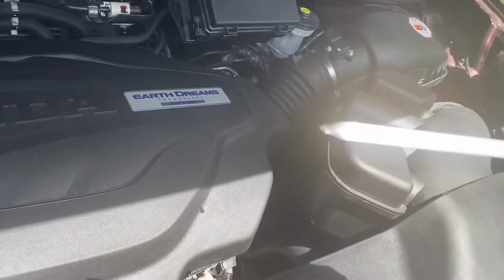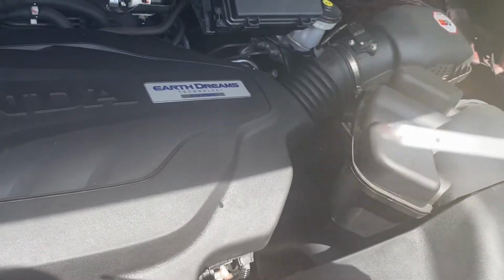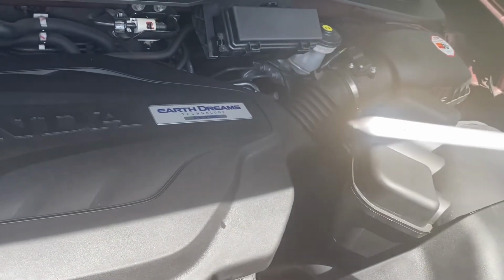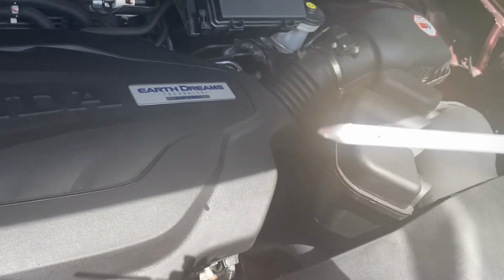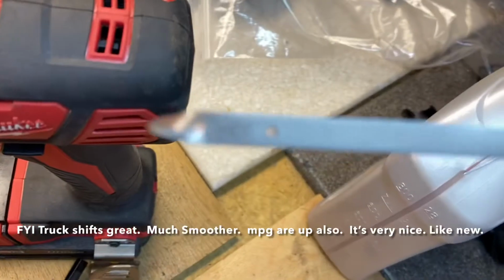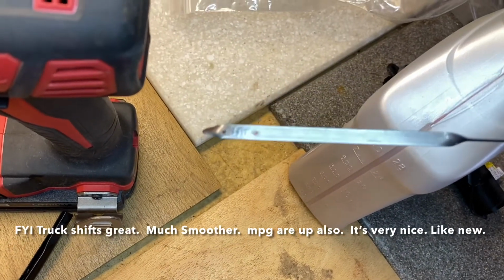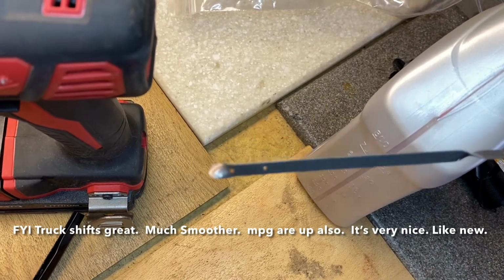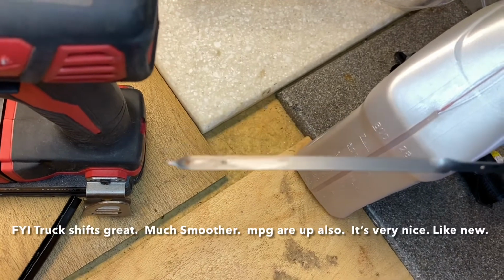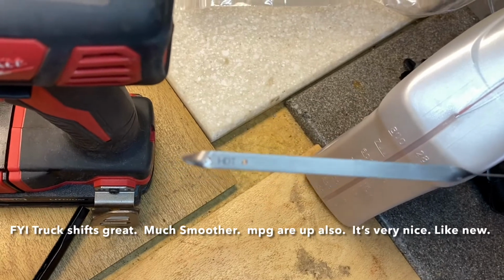That's all it needs to be for right now. And I'm gonna take it for, you know, a nice drive and let it idle, and then check it again in a day or two, and see how it's doing. Ideally, I'm going to get it pretty close to that upper dot, though. The more fluid in there, the better. I'll check in soon. There we go. It's hard to see, but I'm right on the line right now, on the dot, as being full. It's weird. On the backside, it's like all the way up in like another inch. You really got to make sure you check this side, the hot side.